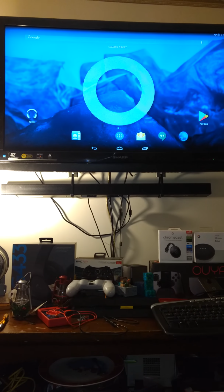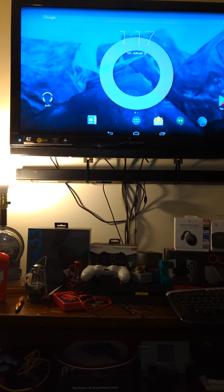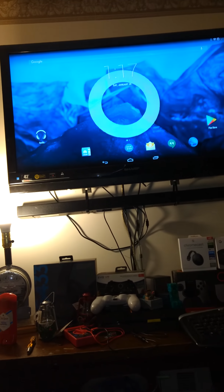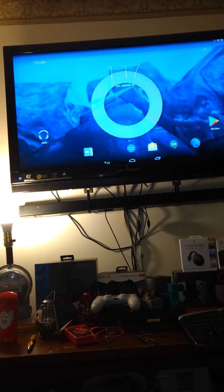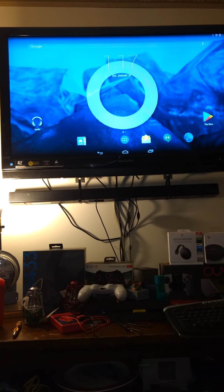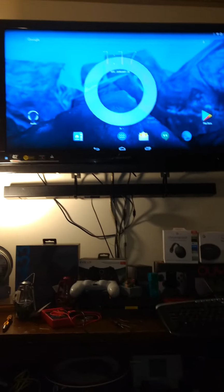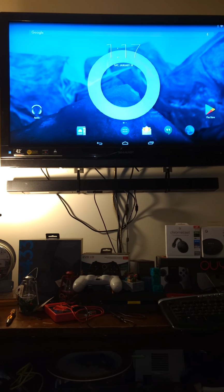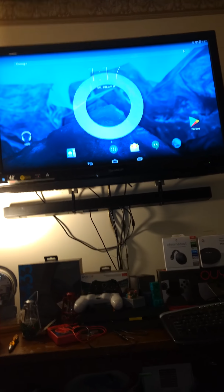And there we go. The ouya still works after replacing the thermal compound and desoldering the heatsink. So, and resoldering it. So it's true that you can replace the thermal compound. I would recommend being skilled with the soldering iron. And I would recommend taking your time, being patient, and just getting to know your device a little. Because if you want the ouya to last any longer in life, this is pretty much what you're going to have to do. Because for mine, the fan was roaring, it would crash randomly. It was struggling. So this was the best solution for me.